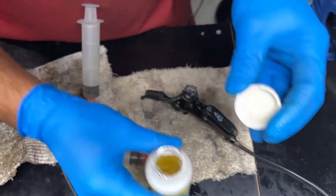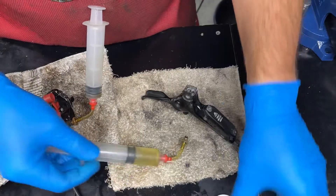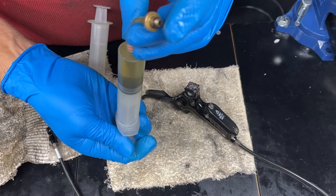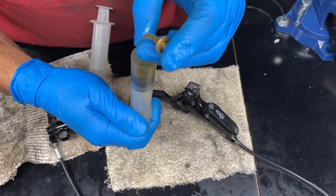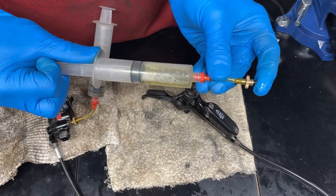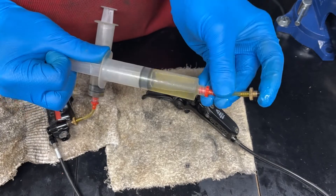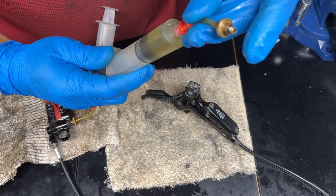It is nice to be able to remove the hydraulic hardware from a bike in order to work on it the way it's supposed to be operated on. These hydraulic brakes are really sensitive and the fluid breaks down — over time you need to replace the fluid because the fluid itself is tearing apart the inside of the brakes. That gray characteristic on the last bleed is actually the hydraulic oil going bad and turning acidic. This isn't something that's discussed so much in the bike industry, but we're talking about it right now — so now you know.